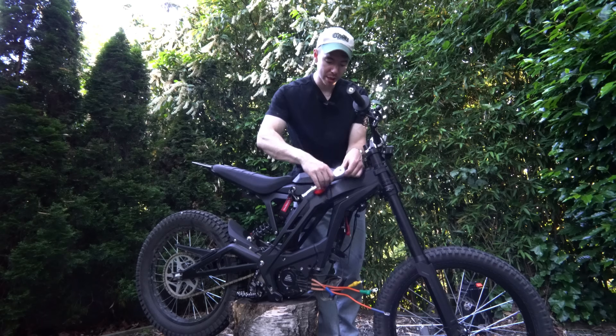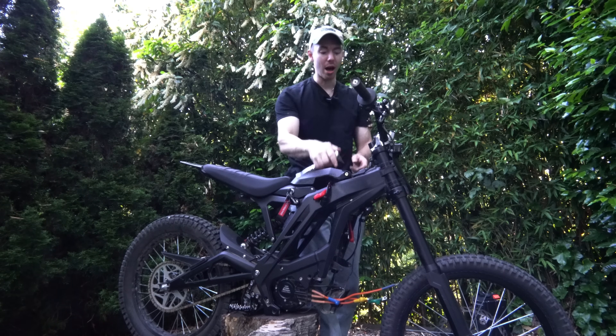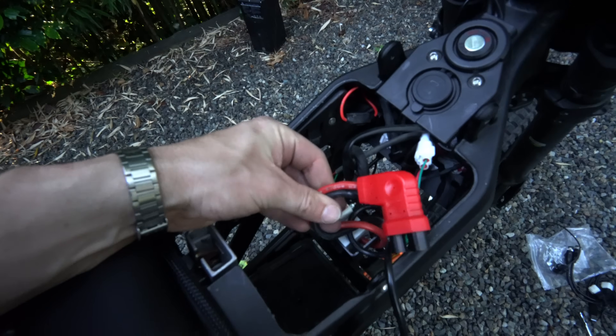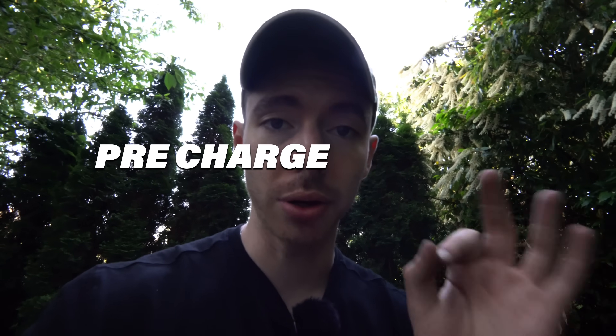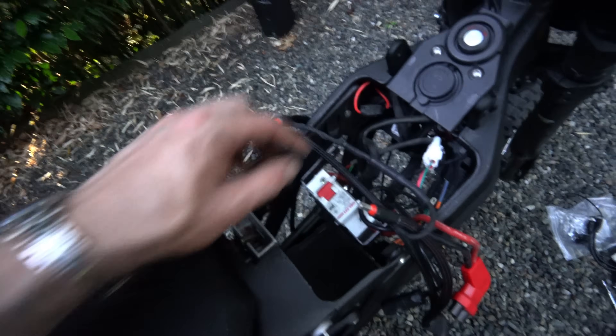With the X9000 you're replacing a lot more wires than on a Surron install, so we need to get into the head tube of the bike. Now that we have the guts opened up, we're replacing the entire battery lead with the one from eBMX — it's supposed to handle more power. Each side bridges the breaker so you maintain your breaker, plus there's a pre-charge resistor. When you flip the breaker it protects the controller from a surge of power rushing in — that's one reason Surrons keep blowing up. Really cool to see that built into the harness.